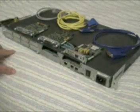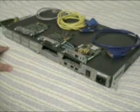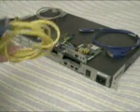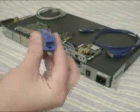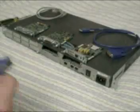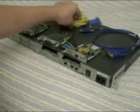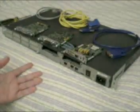In order to configure a Cisco router, you need two things. You need a computer with a serial port — an RS-232 port — and a console cable with a DB9, which has basically an ethernet port on one side and a serial port on the other. Hook this to your computer and the other end to the console port, then use HyperTerminal to get into it and configure it, and after that it should be up and running.